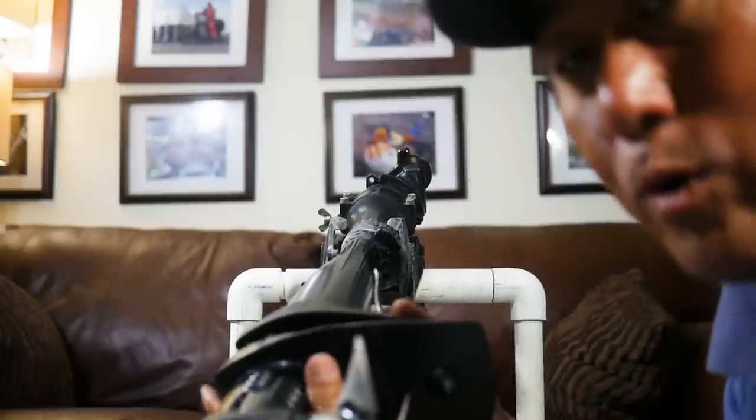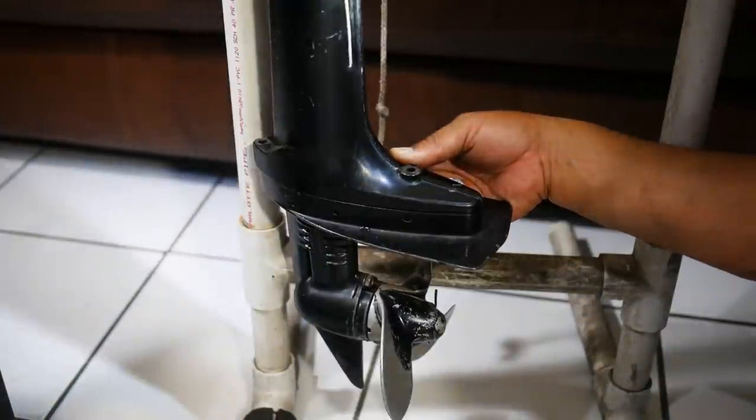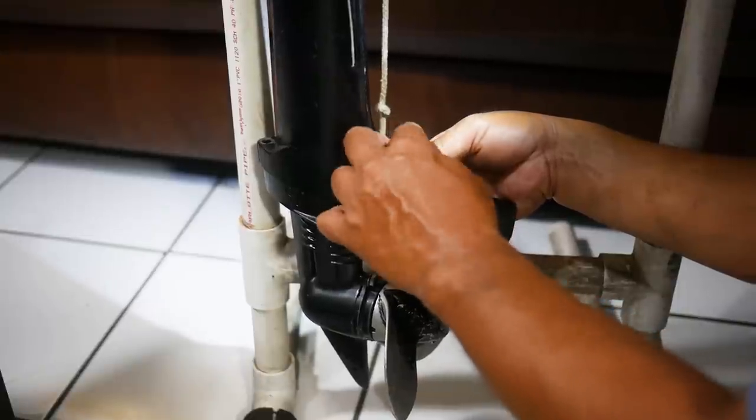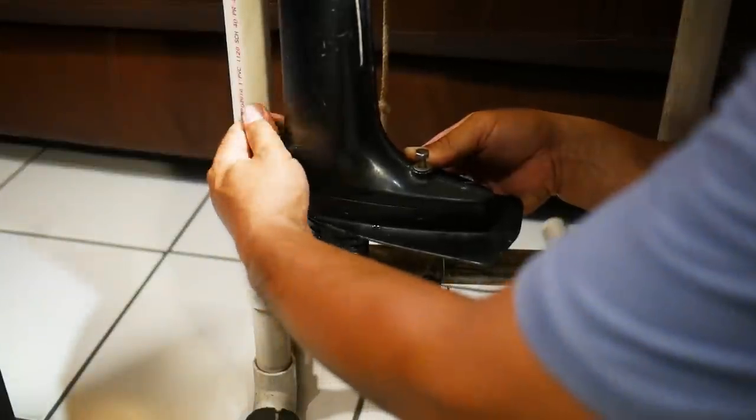You can kind of see the bullseye for the main shaft to go into. Get that in there, find the main shaft, then align the shift lever into the hole so those two are lined up, slide it in, find the water pump hole, line up with the water tube, and then jam it shut. Then it's just a matter of putting the two bolts back in to hold that lower unit together. And that part is done.